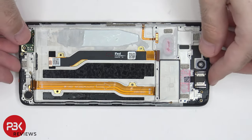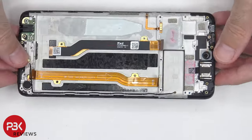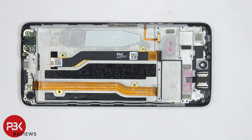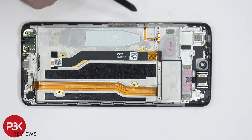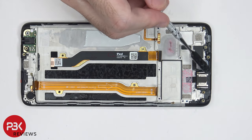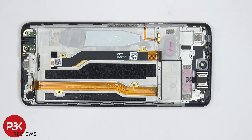At that point, you would heat up the front of the phone where the screen is so you can loosen up the adhesive underneath. You pry your old screen off, apply new adhesive, reapply your new screen, making sure you run the flex cable through the opening over here in the mid frame, and then you would reassemble your phone. The vibrator motor is located over here on the bottom corner. The flex cable for the power button and volume key is located over here, and that's held down with some adhesive so you can gently pry that off if you need. Finally, the earpiece speaker and loudspeaker is located over here on top, which is also held down with adhesive, so if you have to replace that, just gently apply some heat and pry it off.